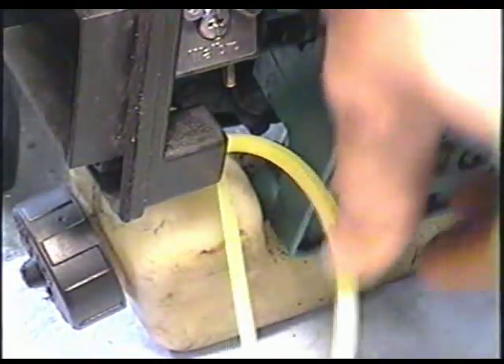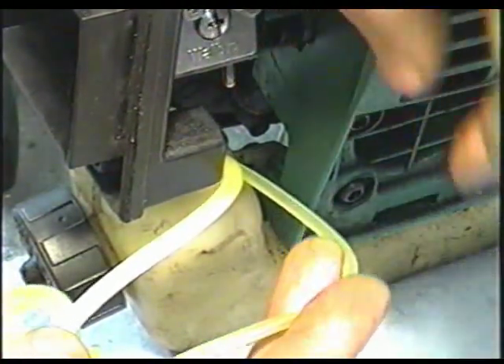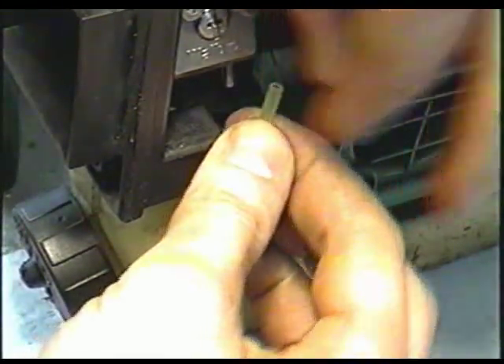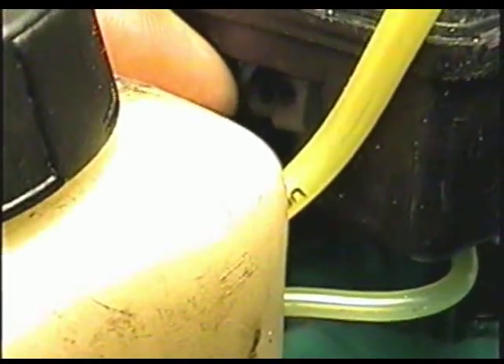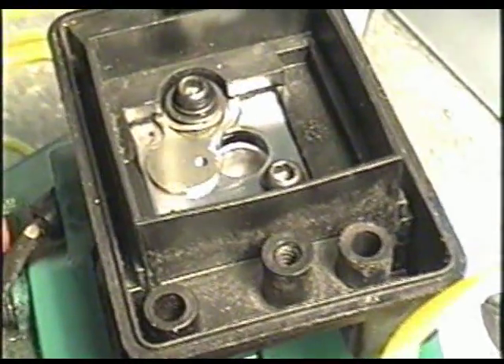Now I'm going to hook up the fuel lines. The small fuel line, which is to the front of both fuel lines, goes to the first connector right here. So you basically line up your fuel line, cut it off, and insert it. You can leave yourself a bit of extra fuel line — it doesn't hurt. Push it in all the way. This fuel line connects to this connector on the carb. If you can't reach this, you can loosen the carburetor — don't take the bolts right off, just loosen it so you can access it with your fingers.